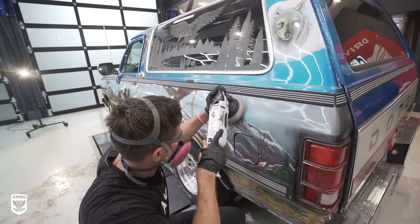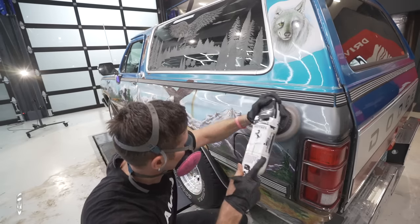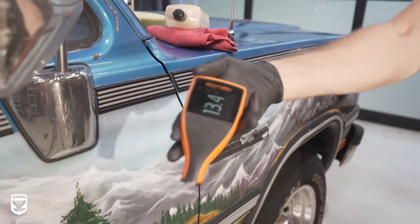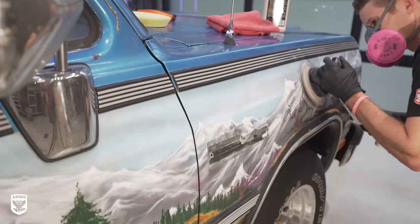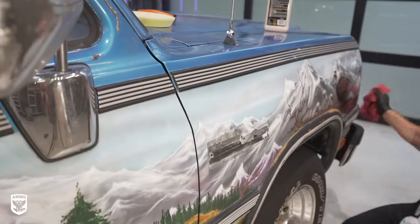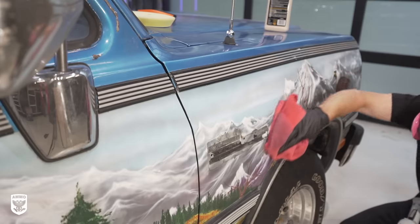On the more sensitive vertical sides of the truck which had the murals, I double checked my measurements. 13 mil is incredibly thick, indicating it had been repainted, which is fairly obvious. However, this time removing the thin or flaky clear coat would be extremely noticeable if I made a mistake, so this was very tricky and slightly stressful.